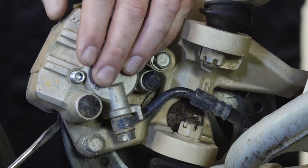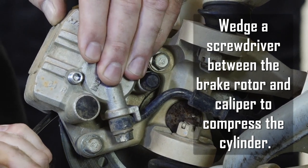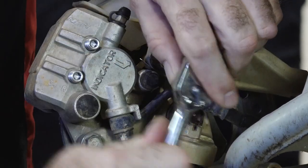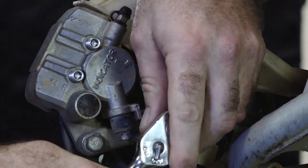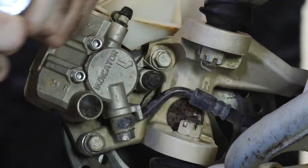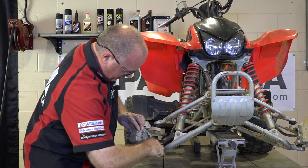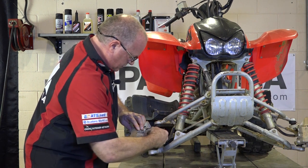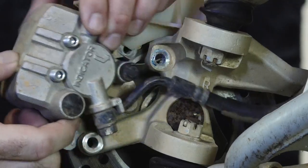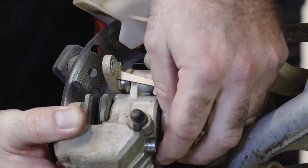From this point, to make our lives a little bit easier, I'm going to go ahead and compress the cylinder on the caliper. At this point we can go and remove our two 12mm bolts that are holding it to the carrier. Once we get the carrier unbolted from the caliper, we can then remove our pads. Lift it off the disc, and as you can see our pads are pretty well worn, so that indicator was spot on.